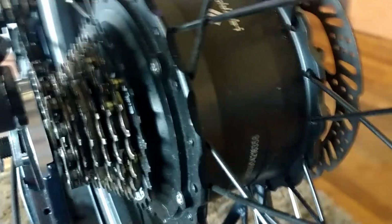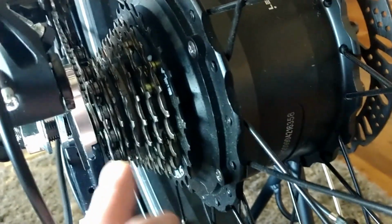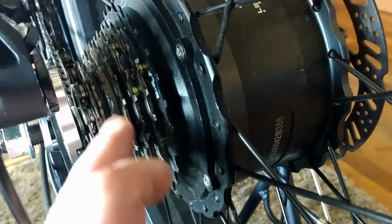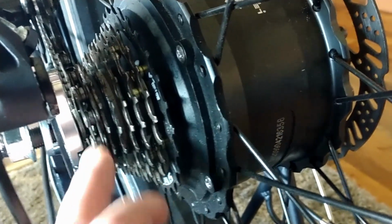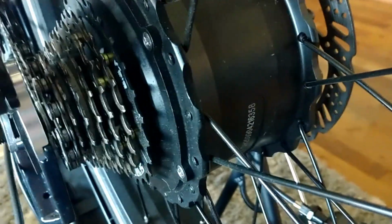Over here, on this side, found something interesting. Wire connector disconnected. I put a small strip of electrical tape around to protect the pins. Of course, I'll have to unthread everything off the wire, pull it up and off very carefully, because I'm going to be putting a new freewheel on, an 11 by 34 in place of the 14 by 28. It gives me better speed capabilities on the higher gears down here, the smaller sprockets. The 11 by 34 is definitely something I need.